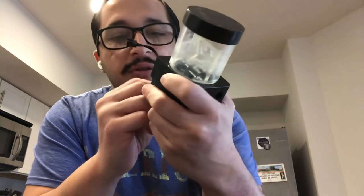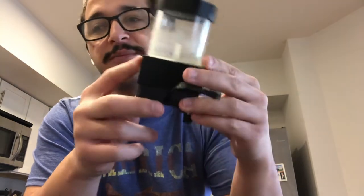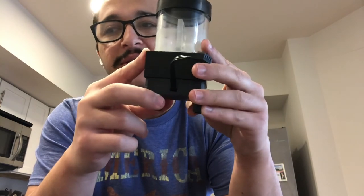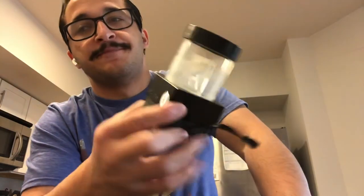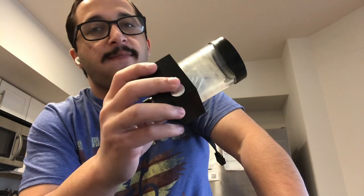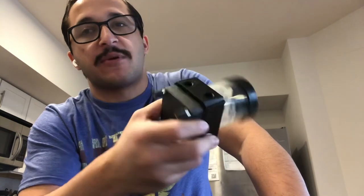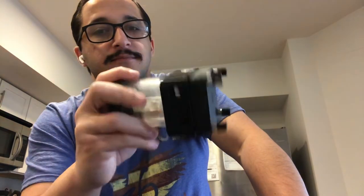So it's a really poor design because there's no way for the water to evacuate without damaging components. So drill an evacuation hole and then put a sponge under there and then just check it. If it's a slow leak, that sponge should be damp and you should be able to notice it and fix your components, but this is too expensive of a component to replace to not have proper safety. So, EK, not shame on you for making this hard to open, but shame on you for not having better safety on such an expensive component.